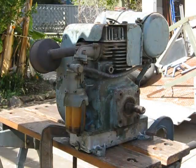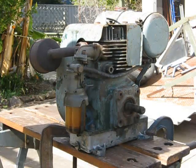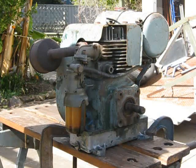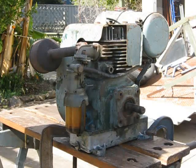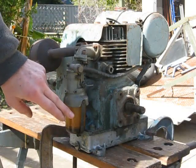We fixed the fuel tap. That did the trick, just soaking the cork in petrol for an hour and then putting a bit of tension on it, put it back together, sealed up perfectly. Okay, so everything's pretty right. We've got oil in our air cleaner.